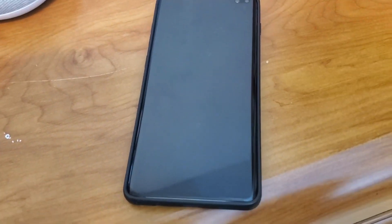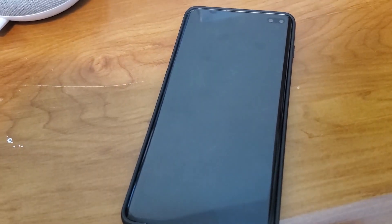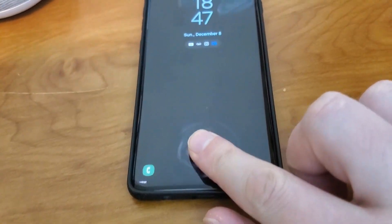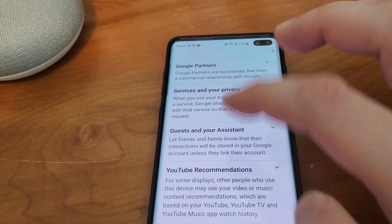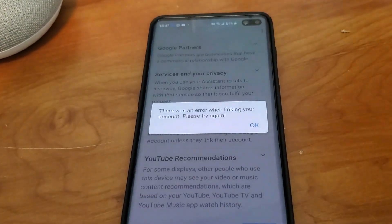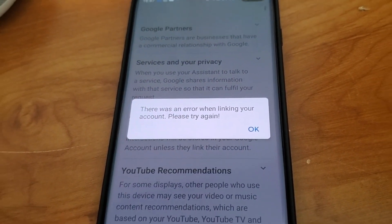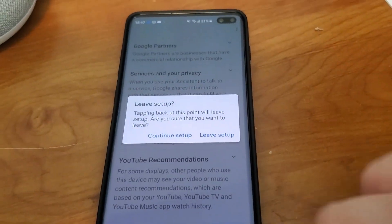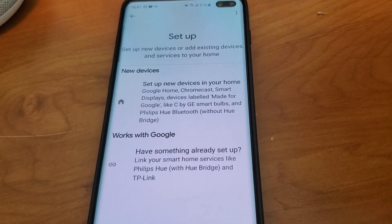Back in December I was setting up four Google Home devices — all different types: Lenovo, the Google Home screen, and the small Google Home Mini — and all of them gave me a very interesting error at the privacy portion. It was not able to connect properly, so you had to abort the entire installation. The device would seem not to be connecting, but as soon as you abort it — as long as you already connected the Wi-Fi settings and your email to it — if you wait about 15–20 minutes, it would actually refresh the entire screen on the device and you would have a perfectly functioning device.